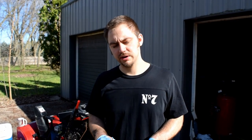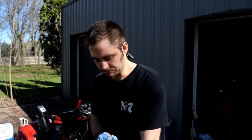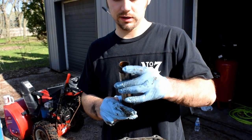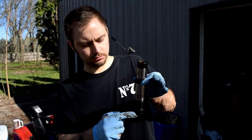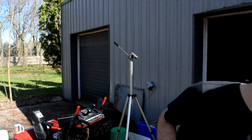There's one more — snap ring number three. Once you get that out, you'll be taking out this long tube right here. It has bushings on the front and back. Note the orientation: double splines on the bottom, single spline up top. Set that aside.